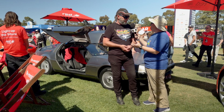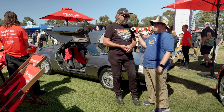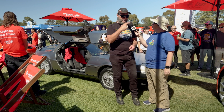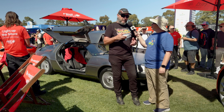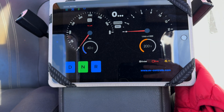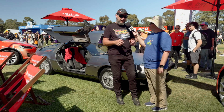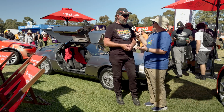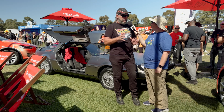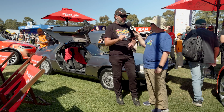Is it one-pedal driving? Does it have gears? Definitely. We haven't fully tested the brakes, which is good because the regen is really good. The other challenge is it wasn't automatic. So at the moment we've just got the gear lever flapping around — we'll probably put some switches in. The motor controller connects to the vehicle, so you turn it on like a normal car with a key. But it's got an added security feature: you need an iPad that's paired with the motor to get it to run. So at the moment we put it into drive using an iPad — it's a big key to carry around. Hence we'll probably put some buttons in. There's just this tablet sitting in the middle of the car, and you've got one passenger, so you want to trust them not to hit reverse while you're driving along.